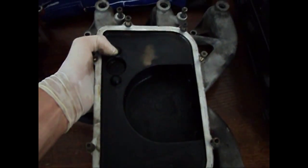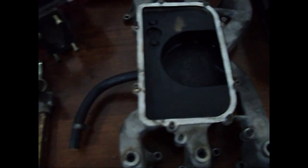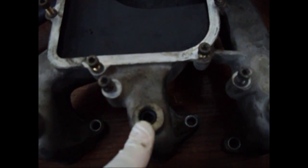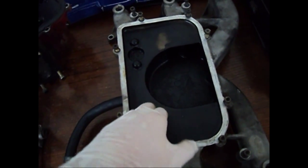The pipes, as you can see here, are rock solid, which is not good, and they are a bit crimped — so that needs to be changed. It goes to show how well the distribution was happening. As we can see, it's all filled with carbon and hard particles as well, which is not a good sign, because the air has to travel through here. The injector lays somewhere here, and when the air passes through, the air-to-fuel mixture ratio happens at this part, according to the valve timing.